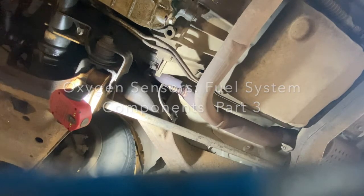Hi everybody, we are back again. Now this time we're underneath the vehicle today. We're going to talk today a little bit about oxygen sensors. Our oxygen sensors are located on the exhaust system. It is really the sniffer of the fuel injection system. The oxygen sensor basically has a function to sample what is going on in the exhaust system and then calculate how much oxygen is in the exhaust system.